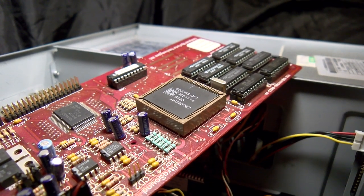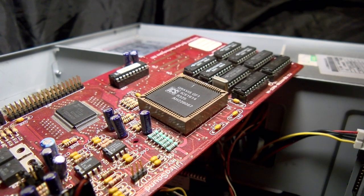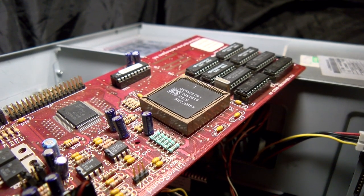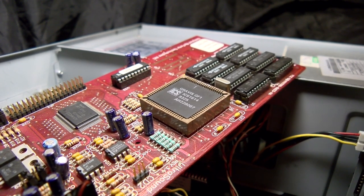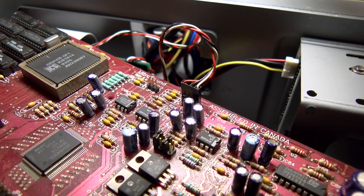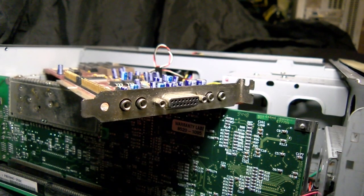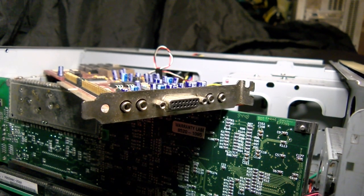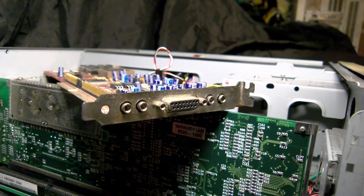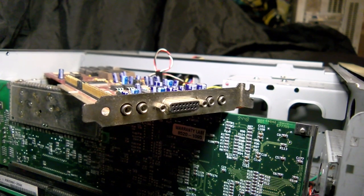Unless you're writing your own stuff for it, there probably is no reason to have more than 1 meg on the card. Many applications will work with even less. This version of the card offers no CD interface, but it does offer CD audio headers in Sony and what I think is MediaVision's old style. At the back, you have the regular ins and outs, including a line-out that allows you to bypass the amplifier. The card offers no PC speaker pass-through of any kind, which is unfortunate. More cards really do need that feature.